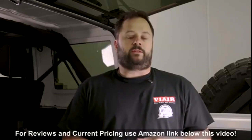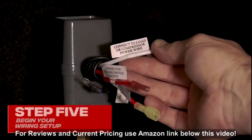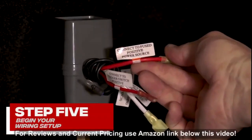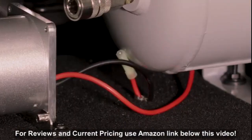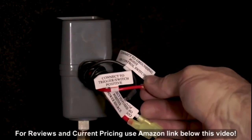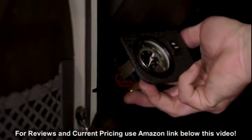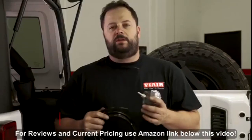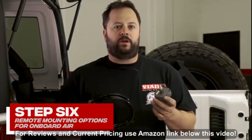One of the great things about this kit when it comes to wiring is that everything is already pre-tagged and clearly marked. The white wire connects to the lead wire that goes directly to the compressor. This red wire is your battery source that includes the fuse holder, which you'll run directly to the battery. This smaller red wire connects to a keyable power source or the in-dash gauge kit. And like most general wiring, the black wire acts as a ground.